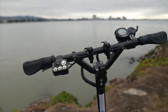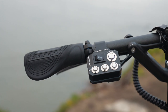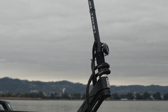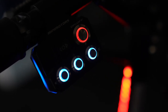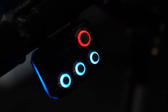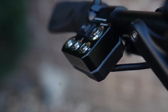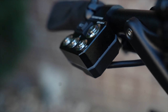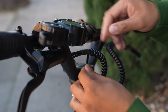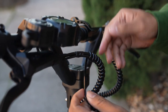The Thunder 2 gets a new cast aluminum control box for turn signals, swag lights, hazard lights, riding modes, and it gets a horn — a feature earlier Dualtrons left out. The backlit stainless steel switches give the scooter a next-generation feel, despite retaining the classic EY3 throttle. The Eco Mode button stays pressed in for Eco Mode and out for Turbo Mode, so you can tell what mode you're in before you squeeze the throttle. The cables look very tidy, but aren't plug-and-play, so component changes are going to take a little longer.